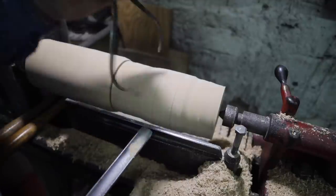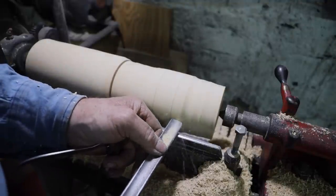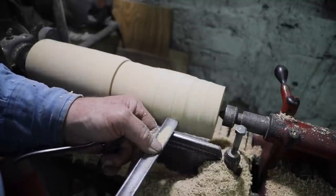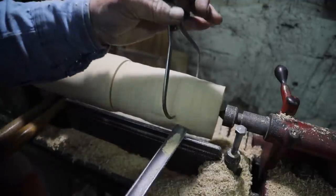So you'll notice as I put the taper in the 5/8, that 5/8 measurement actually lengthens. See it here? So once I put the taper in, I'm actually going to have to shoulder that back to my 5/8 again.